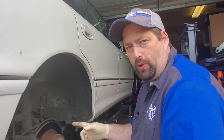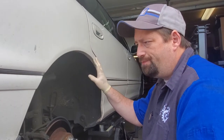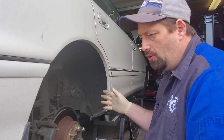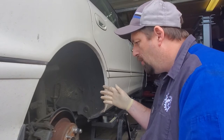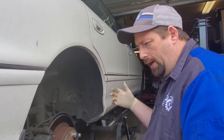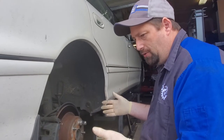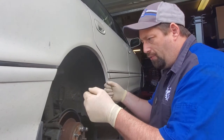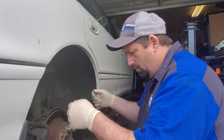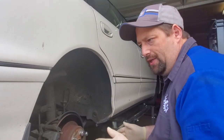Welcome back. This is going to be a quick video — we are working on a 1998 Toyota Avalon. The customer's complaint is they feel brake pulsation or oscillation when braking. I test drove the car and it does do that. Usually when you have warped rotors causing a vibration in the front, your steering wheel will wiggle, and the faster you're going the more it will oscillate. If it's from the rear, you'll feel it behind you or in your seat.